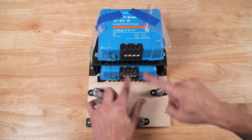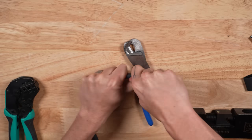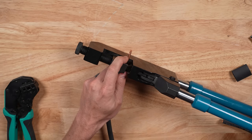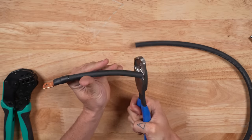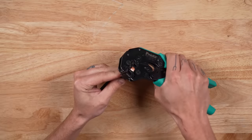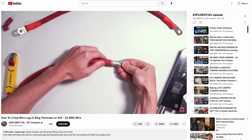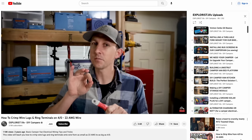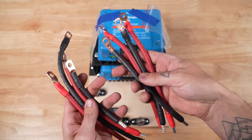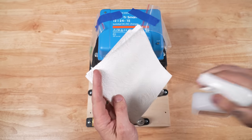We will be making our wires as noted from the wiring diagram on our product page for this kit, which I'll link to in the video description. For each one I'll cut, strip, crimp, and heat shrink a ferrule onto the other end as appropriate. I have specific videos for crimping lugs and ferrules onto wires that I'll leave in the video description below. And now is a good time to go ahead and clean the lugs and ferrules to make a nice clean electrical surface.